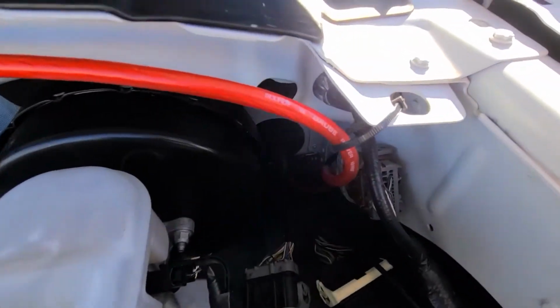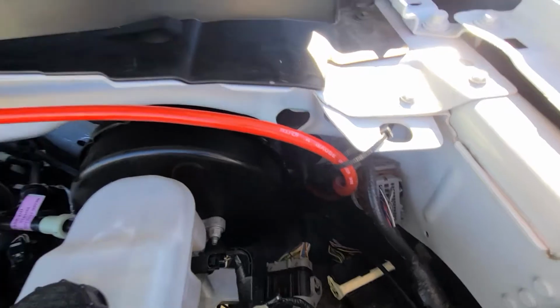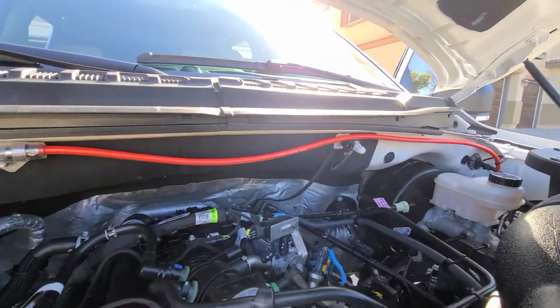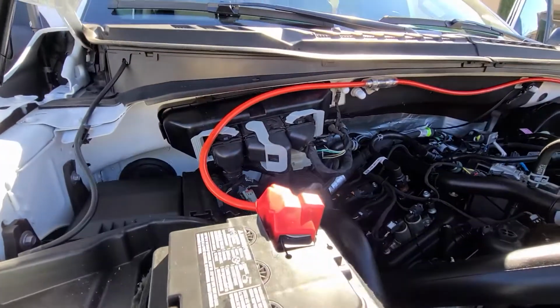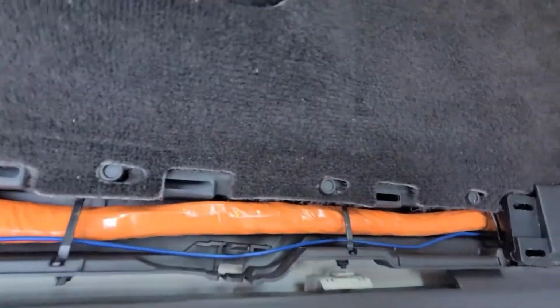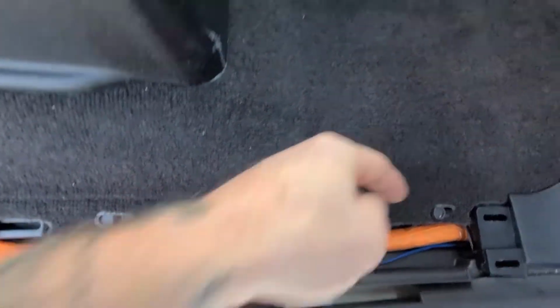So the power line comes out from the boot down there, runs up here. I'm gonna tighten this up and snug it up, put the loom on it, connects to power here. And going back to this other side, the remote wire, like I said, here's the remote wire. I have it on a tap fuse, but I didn't plug it in. I just have it ready in case I ever need it. But this amp, like I said, automatically turns on with the speaker level inputs.